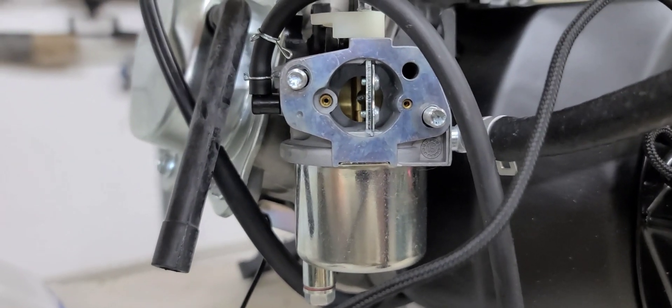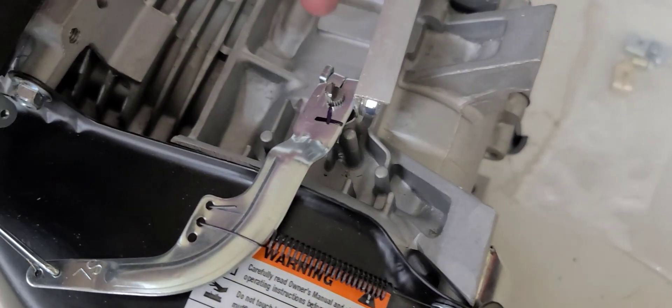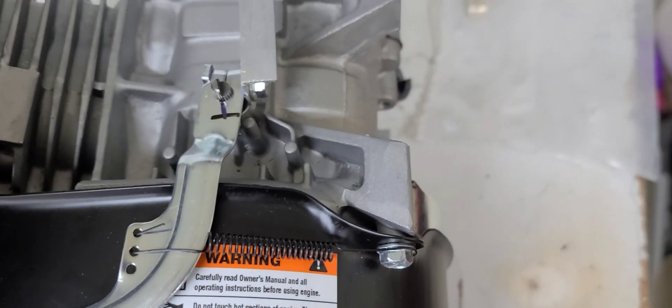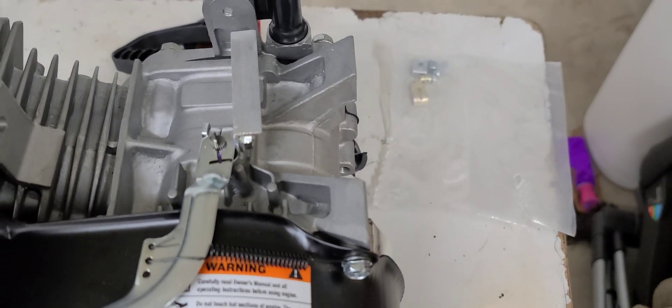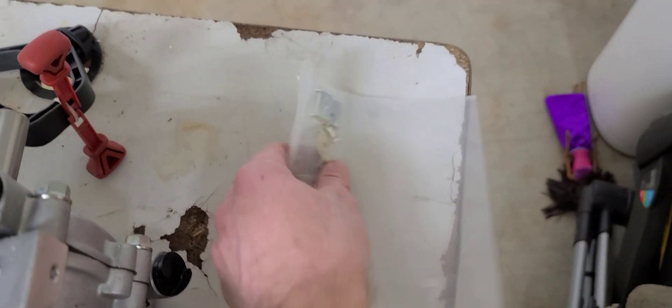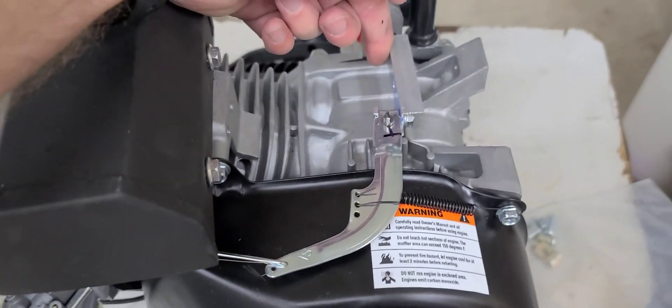That's the choke — this little tab up here. So what I did was to try to rig up a throttle here. I put this piece of angle aluminum and bolted it to the governor arm. I'm going to drill some holes through there and put a piece of angle aluminum right there. It has these M8 bolts for where a tank would bolt up, and then I'm going to put a throttle cable fitting through it and drill a hole through here with the throttle stop.